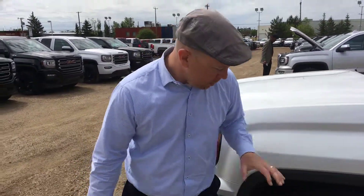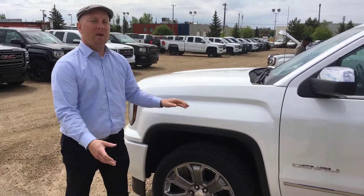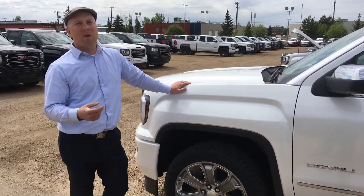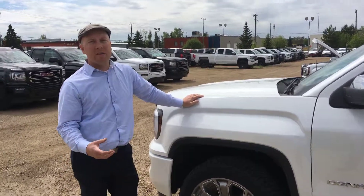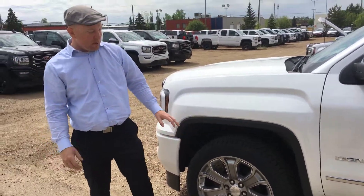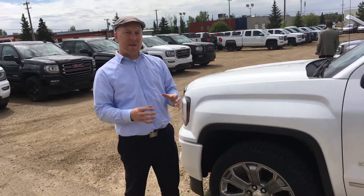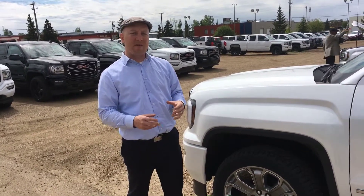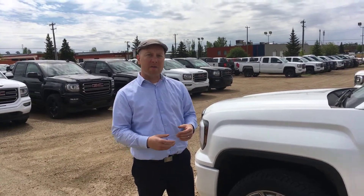You have the new Durlife rotors installed, so they last a lot longer — almost twice as long as the old ones. It's hardened steel. You do have your Denali rims here. This also has magnetic ride control, so the vehicle reads the condition of the road and induces a voltage in your shocks to give you the proper ride you need, whether it's a stiffer ride or a softer ride.